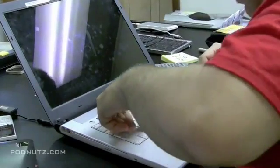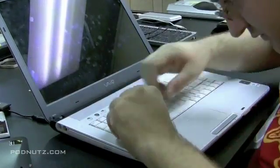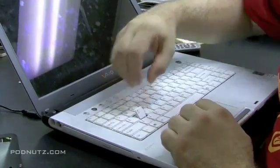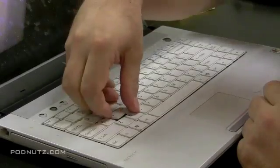To get a key off, just pull it up from the correct side. You don't want to force these keys because it's very delicate underneath and it'll break. But if you just pick a side and start pulling up, eventually one of them will detach and that's the side you should pick it up from.